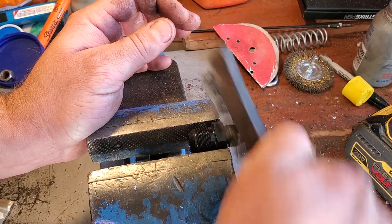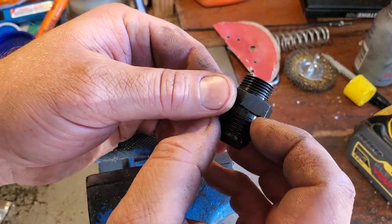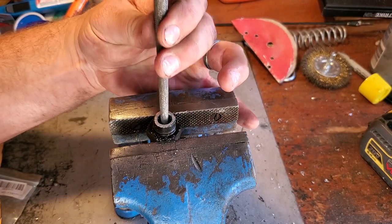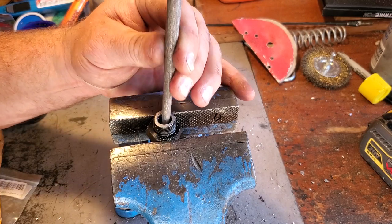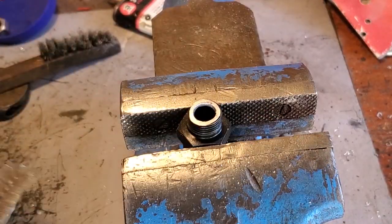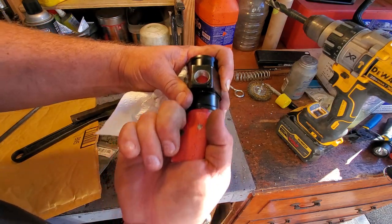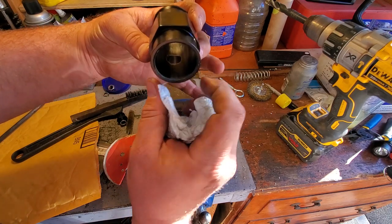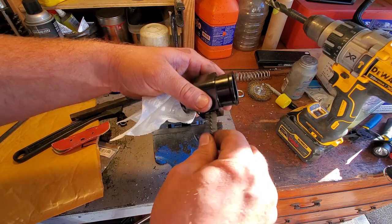Not a bad cut — just want to clean up these threads a little bit. Martin, I agree with you — I think it's an excellent idea to eliminate any possibilities of air bubbles sticking in here, so just beveling out this edge a little bit. Clean up any aluminum shavings, and I'm just going to deburr the inside of this hole. Make sure there's nothing protruding out the bottom — don't want any air to get caught in here. Looking nice and smooth.